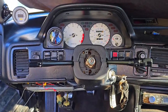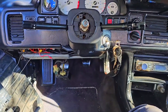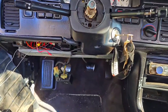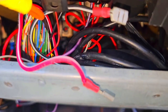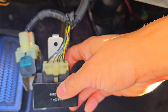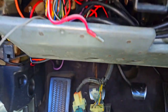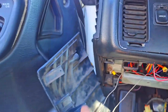Real quick, how to diagnose a failed fuel pump. At first I thought it was the main relay — it's a very common part in all these 80s, 90s, and even early 2000s Hondas for the solder points to go out. Under further investigation I found out it was not the main relay. I'll show you exactly where it's at. The main relay bolts up to a hole, and to the right of that mounting point is another component right next to it. You have to take off the whole bottom portion of the dash to access it — extension and 10 millimeter.